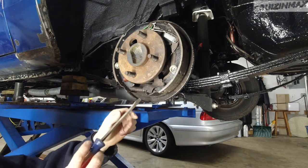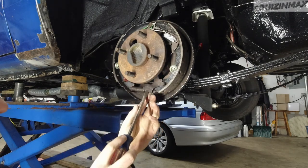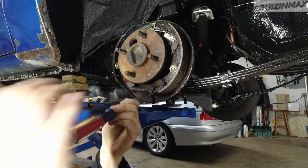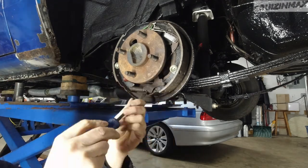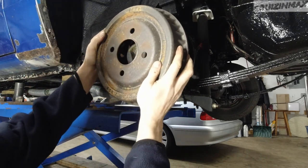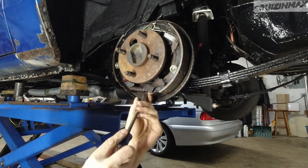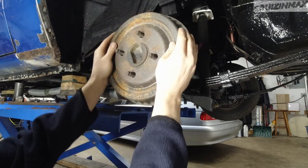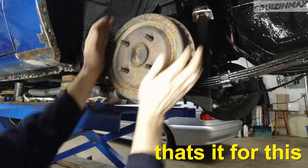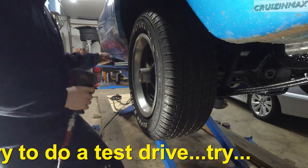What you need to do is unscrew the adjuster screw from its base — in this case it's got to come down. Just going by the thread. If it turns out, try the drum. It doesn't fit — went too far, so now I've got to lift this locking tab and go back up. I'm getting a little drag, which is what I want. That's it!